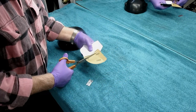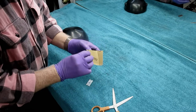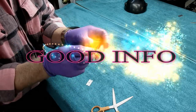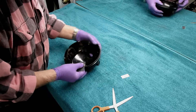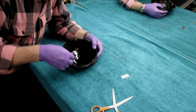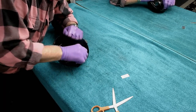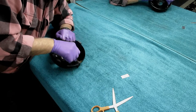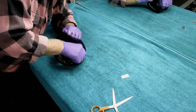This is sticky-back paper, 60 grit. You just take a piece and because it's sticky back, you fold it over twice or three times and you've got a nice little sanding tool — just perfect for getting down in there. I thought in the beginning this part was going to be relatively quick, a couple hours and we'd have it prepped, but it looks like it's going to need a lot more prep. We're never going to skimp on prep — it's like skimping on the foundation of a house. That tool lets me get down in those little cracks and crevices.